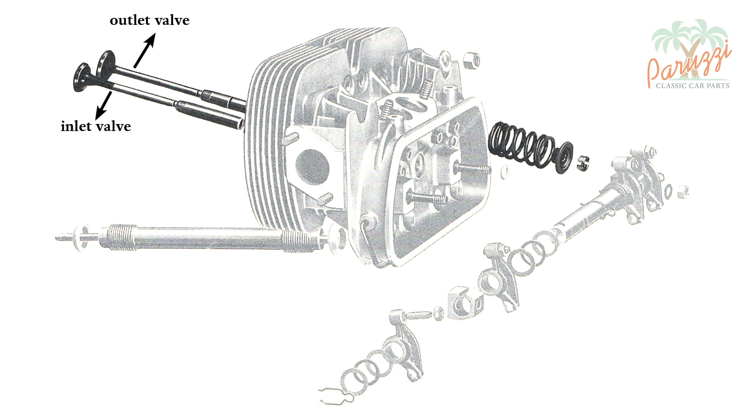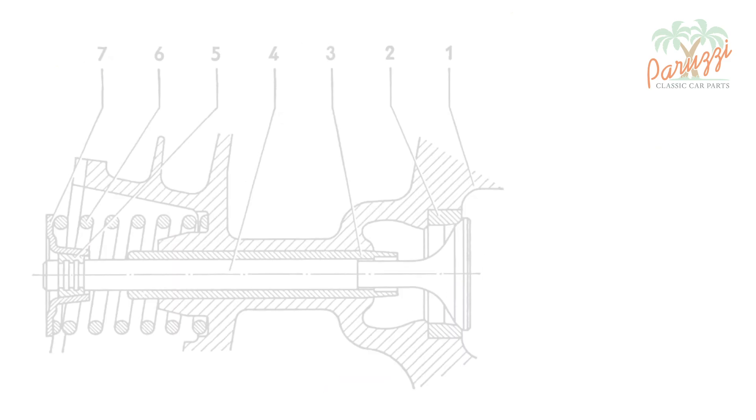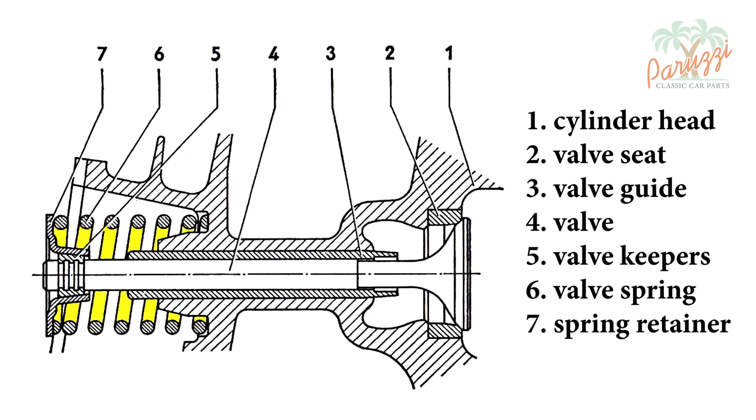On the left you see the intake and exhaust valve of one cylinder. These slide into the valve guides. On the outside of the cylinder head, the valves are forcefully held closed by valve springs. The valve spring retainer holds the valve springs under pressure, and are secured by valve cotters — also called valve keepers or valve locks — that fit into grooves in the valve stem. The following drawing is a cross-sectional view of a cylinder head showing valve and valve spring. The valve is pressed under tension against the valve seat in the cylinder head by the valve spring. To keep the valve spring under pressure, a valve spring retainer is used. The spring retainer is secured to the valve stem by two valve keepers. To disassemble the valve, you will need to depress the valve spring retainer to loosen and remove the two valve keepers. Once the valve keepers are removed, the valve spring is free and the whole assembly can be disassembled.